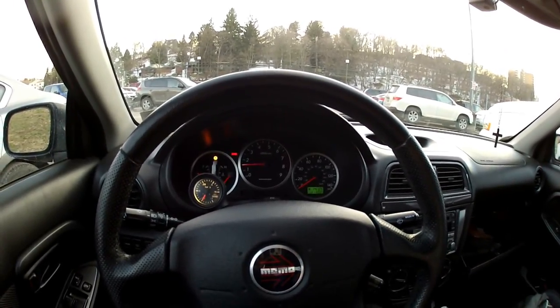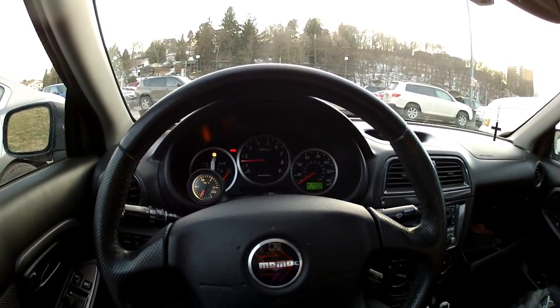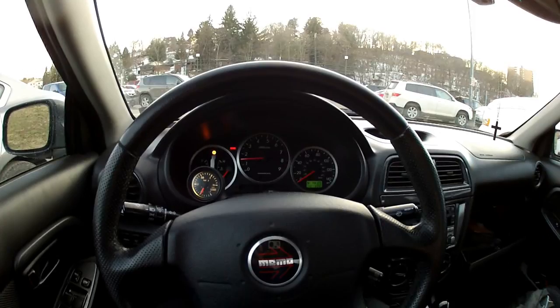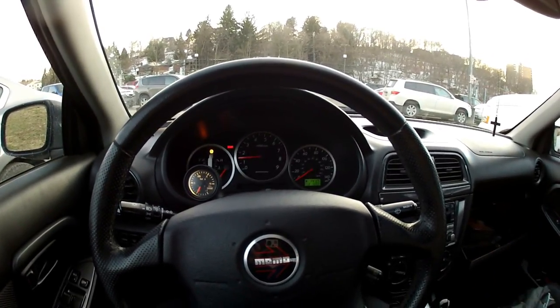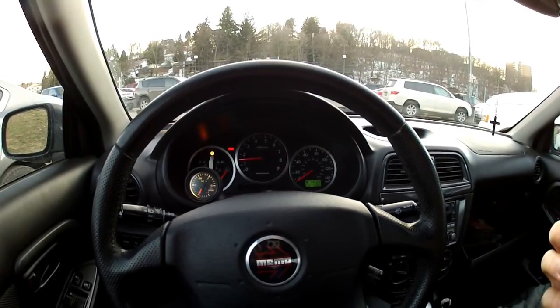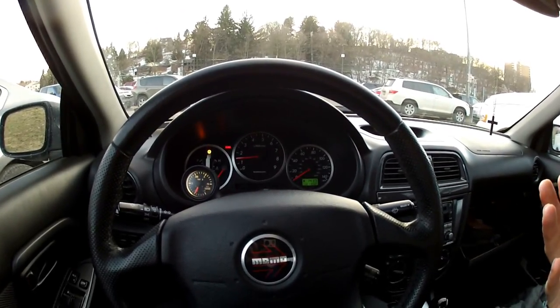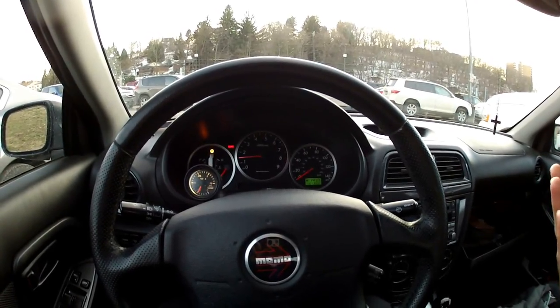But as you're driving, there's load on the engine. It's going to warm up a lot quicker, and that's going to allow for less wear and tear on the engine, just as if you warmed it up completely every single time. So you've got to come to a happy medium. Don't just turn it on and go, but also don't let it idle for 10, 15 minutes and then leave when it's fully warm. You don't really need to do that.